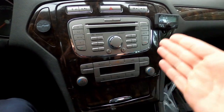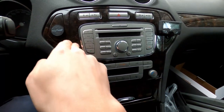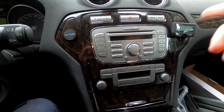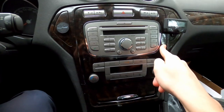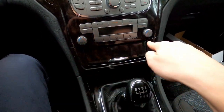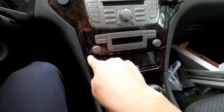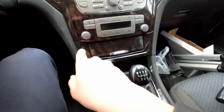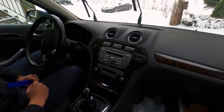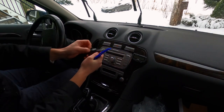To install it we will have to remove the old radio. To do that there are four screws — two on this side and two on that side. To access them we'll have to remove this panel, and to do that you need to take out six screws: two on this side, two on that side, and two down here. To access the lower screws you just remove this little thing right there.